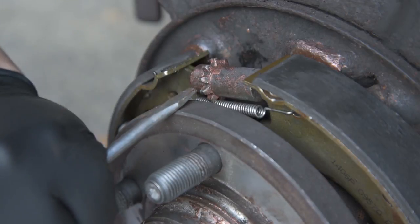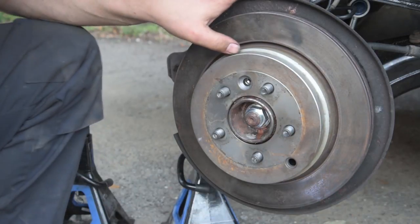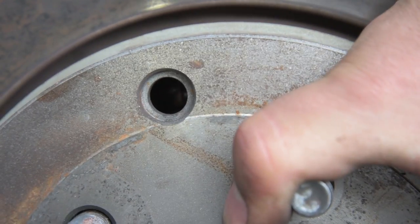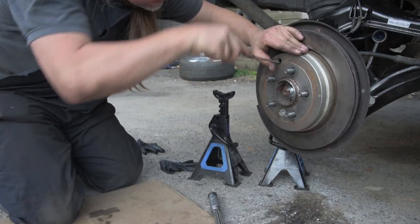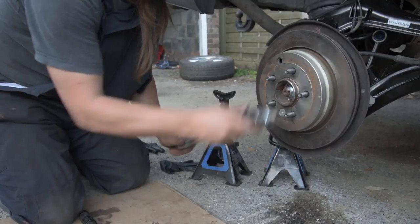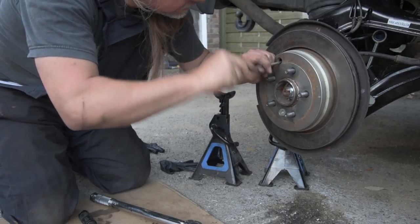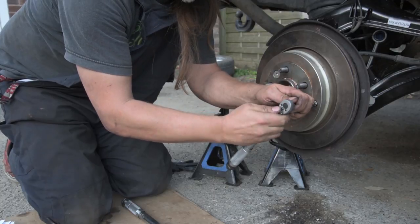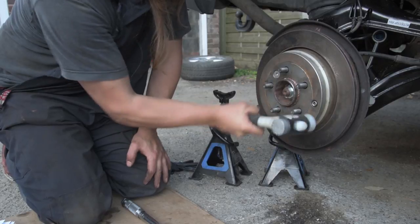They're adjusted with a screwdriver, tighter, looser, but it has to be done with the disc in place. Align a hole to where the adjuster is and poke a screwdriver in there. Then I check the tension using my torque wrench. Then I loosen the adjuster as per the instructions. Then make sure the pads are set nicely, and I'm done.